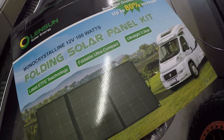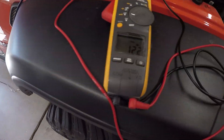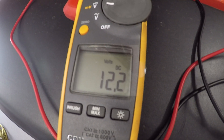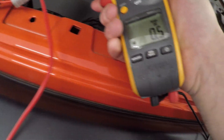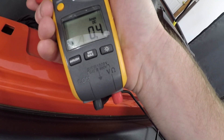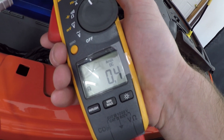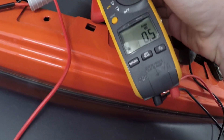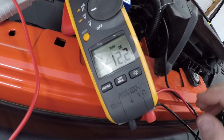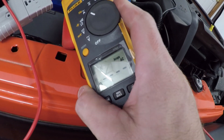It's out right behind the Jeep right now. I haven't plugged in the actual panel to the charge circuit yet, but we're going to look at that. The Jeep's been parked for a couple days and the battery is sitting at about 12.2 volts. There's no current flowing through the charger yet — there's a little bit of residual that back-feeds the solar panel to turn the display on, so effectively about half an amp to run the display.